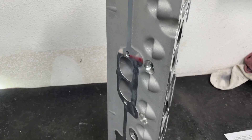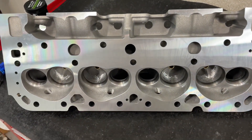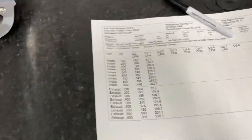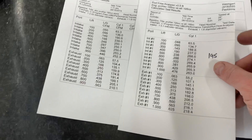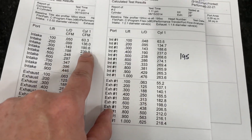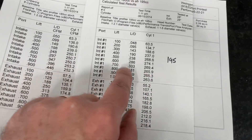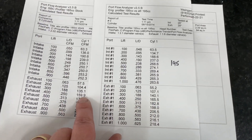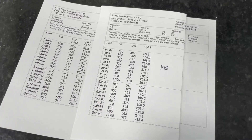Thanks for listening - I appreciate all the people that have subscribed. In conclusion, for a 185cc head this is the best 180 to 190cc head as-cast I've seen - the flow numbers are pretty good. In case you're wondering how it compares to the 195, going back to my other videos I compared the 195 to an AFR 195: the 185 Profiler flows 239 at 0.400 versus 237 for the AFR 195 - so it actually flows better at 0.400 lift. At 0.600 it's 251 versus 274 so the 195 definitely flows more there. On the exhaust: raised versus stock is 160 versus 166. Thanks for watching, take care.